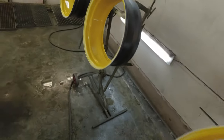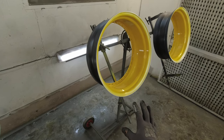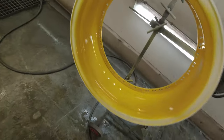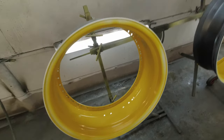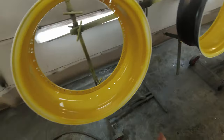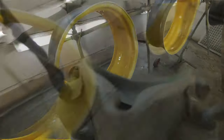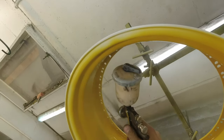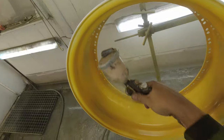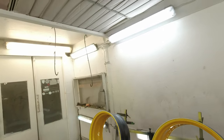A thin coat — I'm going to let this dry for 10 minutes, then the second coat of the same color. And then over to the magic. The base yellow has cured and it's ready for the second stage of yellow, and that's with a lot of pearl. That's when the shine happens. So let's put that coat on. That's going to cure for about 15 to 20 minutes. I'm going to go sand some other parts and let it dry, then time for clear coat.